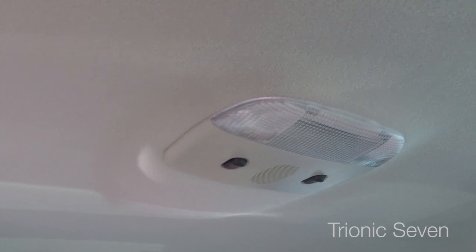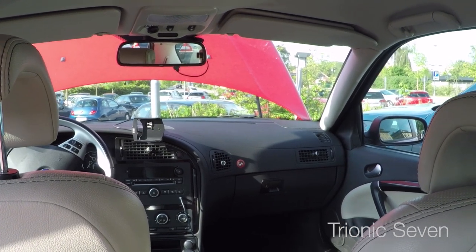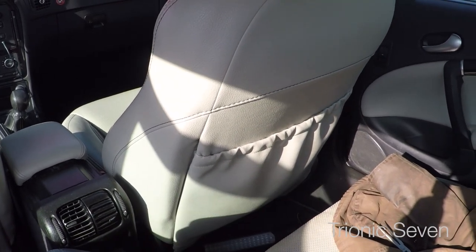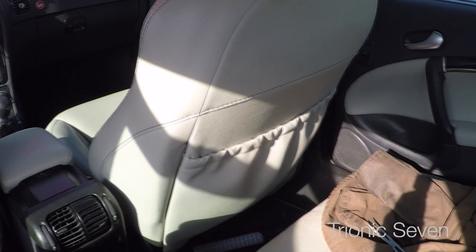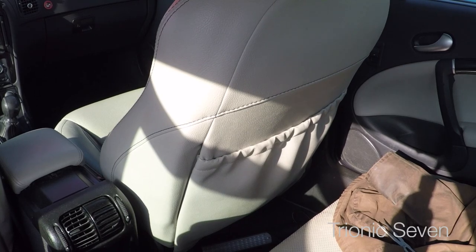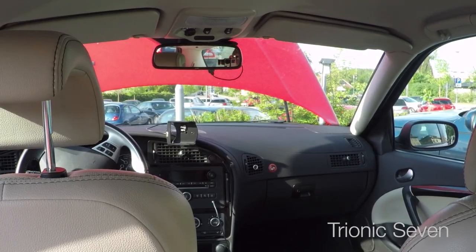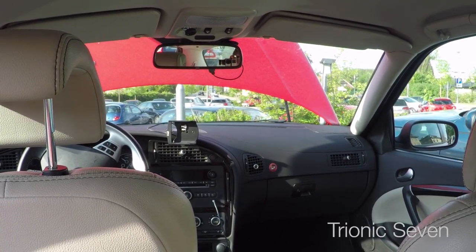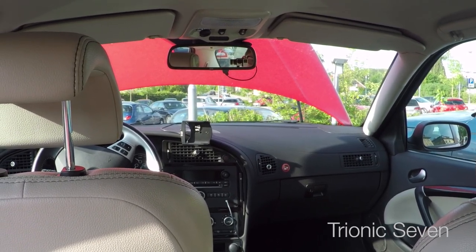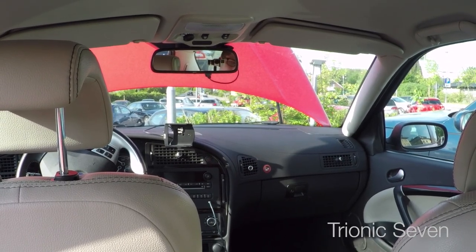For this car we are done. All the sensors have been installed including the switch for the hood and the siren - that's everything you need. You can also have a tilt sensor installed - that's optional and I think it goes under the seat, but it's a bit annoying if you're going on a ferry. My recommendation is to double check that the hood can open and close correctly. The car now has all the components it needs for the alarm to function, but it has no idea we've just installed a car alarm. We need to program it and that can only be done with a specific Tech 2 instrument. I don't own a Tech 2 but I know a few friends who do, so in the next shot we'll be visiting one of them.